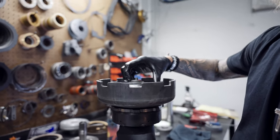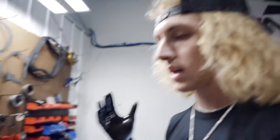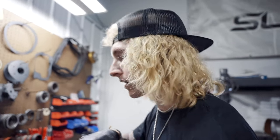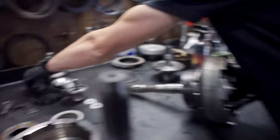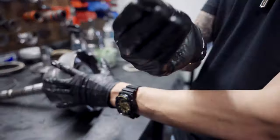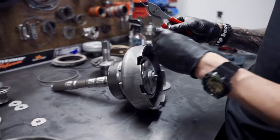We are recessed in there, but as you've seen, there wasn't that recessed area to put the snap ring. So sometimes you can get a thinner or thicker thrust that'll cause the planetary to stack out properly where your snap ring goes. So anyways, now that that's good, we will put our snap ring on this. Then we're going to measure it out.